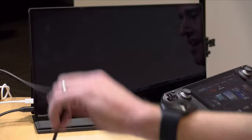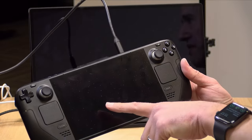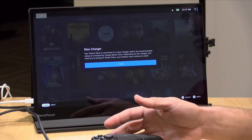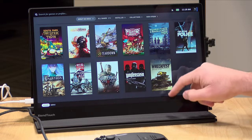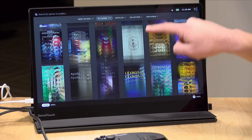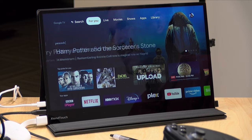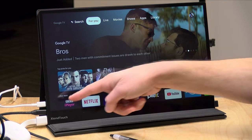I plugged in the Steam Deck — a device running a customized version of Linux for gaming. Plugging in the USB-C cable gives a warning about the charger being too slow, which is that 5V 1A issue we mentioned. But the touch works with no problem — you get touch functionality on the Steam Deck using this display without any drivers, completely plug and play, which was a nice surprise. Like the Switch, the Steam Deck has only a single USB-C port and won't get enough power from the display to charge while gaming, so you'll need a USB-C dock with its own power source, which will eliminate touch compatibility since video will come through HDMI.